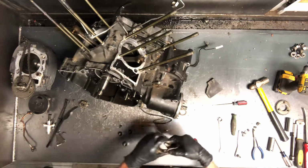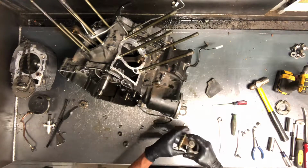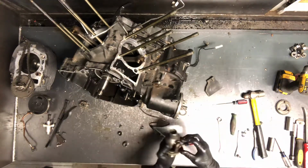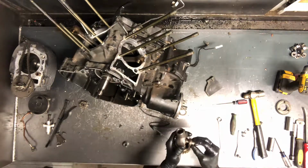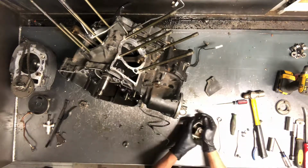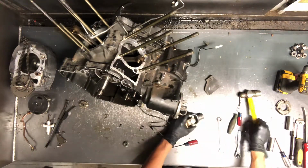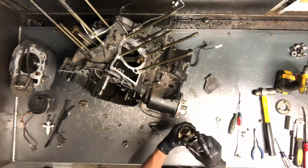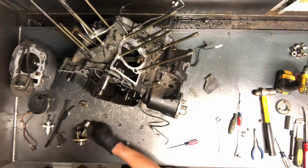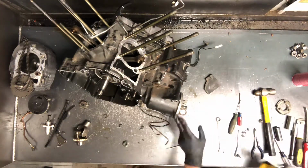Now going back together, kind of the same thing. Stick it in here like this. A lot easier to do it on a vise, but we'll try to get the same thing done here. And then I'll tap down on that cap, kind of holding up on that yoke so those pins don't go everywhere. All right, those are in. Now we'll just get them down far enough to where we can get those clips on there. We've got 3 12mm bolts back here to remove that cover.